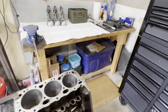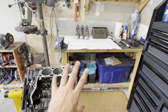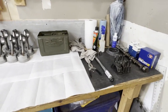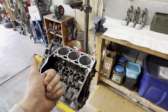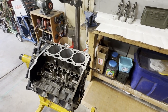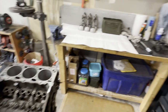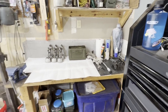There is going to be a method to the madness today. The first thing I've done off camera is clean the block, pistons, rods, all the crank, camshaft, and main caps. If you haven't already checked it out, just check out my last video. You can see how we did the dingle ball hone on the cylinder walls to break the glaze, get a good crosshatch on there, as well as polish the crank.